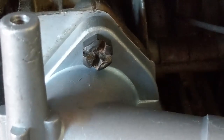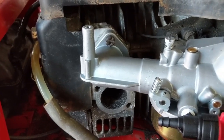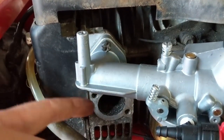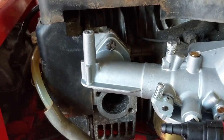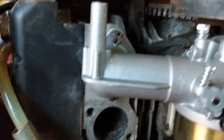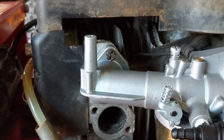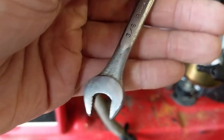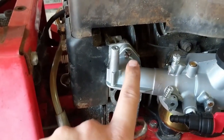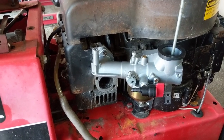These intake bolts have two slots — you could use a slotted screwdriver but I don't like to round off the head. I get them snug hand-tight with a number three Phillips, then snug them up with an open-end wrench so they're tight top and bottom. Using a three-eighths inch open-end wrench I got about a quarter more turn, so now I'm ready to reinstall the muffler.